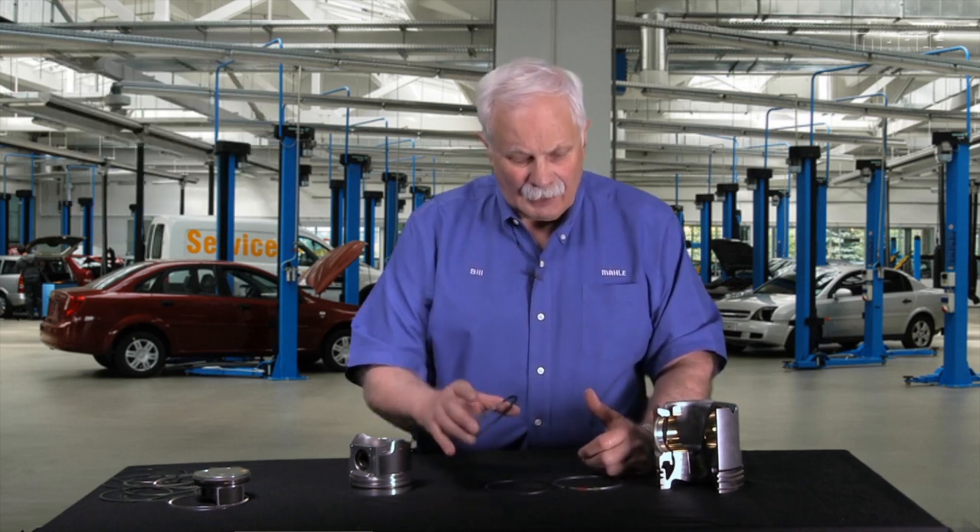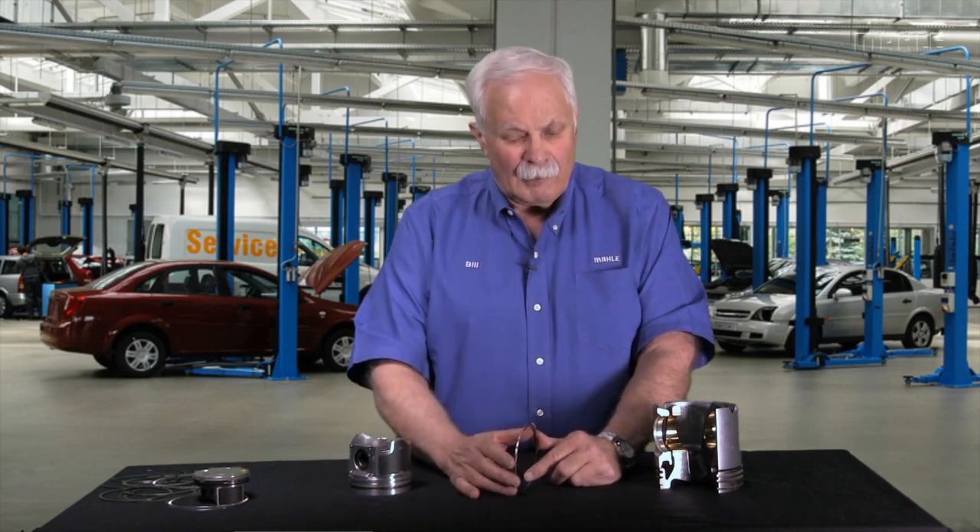The two-piece design is somewhat more expensive than the three-piece design, so it's used primarily for these diesel engines where we have the ability to spend more money on the ring pack and expect the engine to last longer. Now the other big difference in diesel engines is that many of them — even the pickup truck diesels and of course all the bigger ones — use a top compression ring that's what we call a keystone design. In the keystone design, from the face of the ring to the backside, both sides taper in and the ring gets smaller — it actually looks like a keystone.